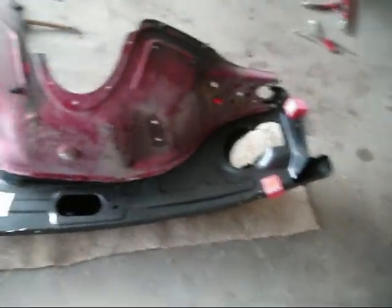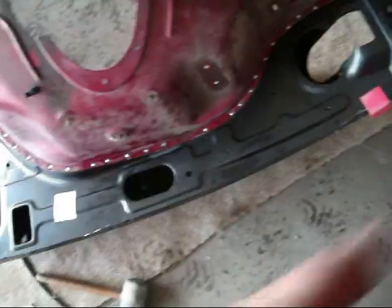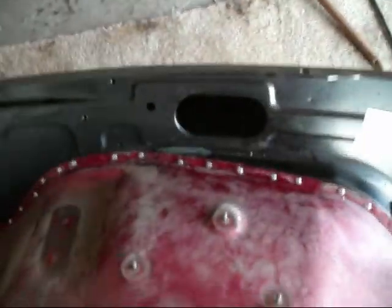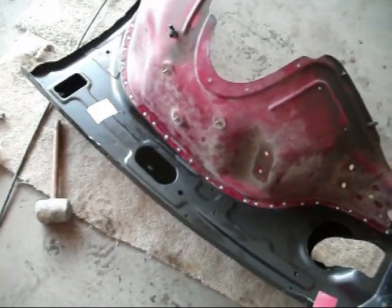Then I get to have the fun of changing the other fender because it's doing the same thing. The whole truck's going to go in for a fresh coat of paint. I decided to go with the screws rather than welding. Wherever there was a hole from drilling out a spot weld, I put one of these big-headed tek screws in — you can buy them at Menards, a 260-pack for about $6, self-drilling. So here it is, basically ready to go back on. You could paint the inside first, but you won't see it when the hood's shut — it'll be covered by the airbox and battery cover.